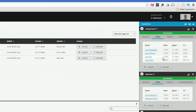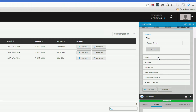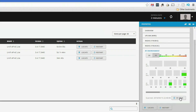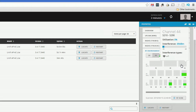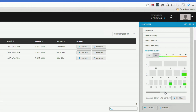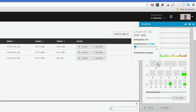If you're into the geeky side of wireless network setup, there is a lot to look at here. One really cool thing is the wireless environment setting. They have an RF environment scan where it goes out to all available wireless channels and gives you an idea of how saturated those channels are. This is really helpful in an urban environment where you have a lot of neighbors with Wi-Fi, cordless phones, or other interfering devices. Not only does it look for other wireless networks, but also other things using those bands.